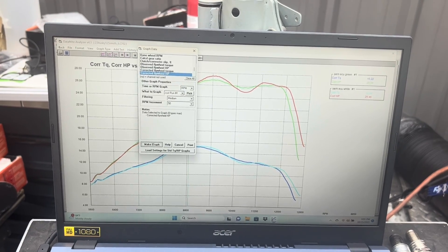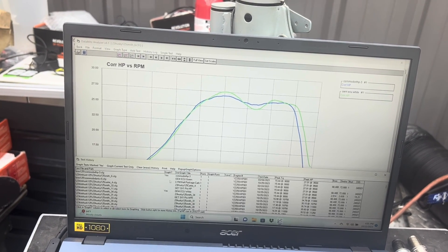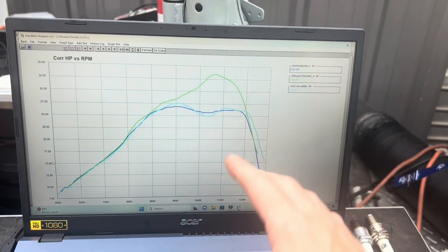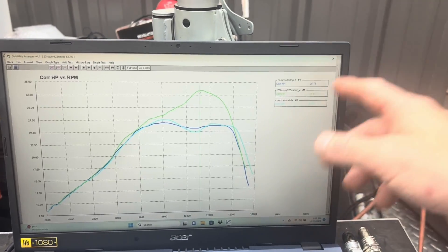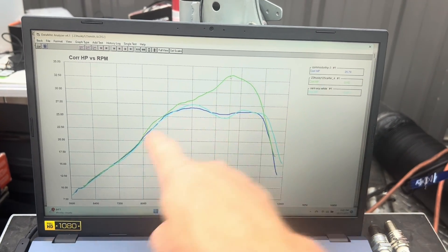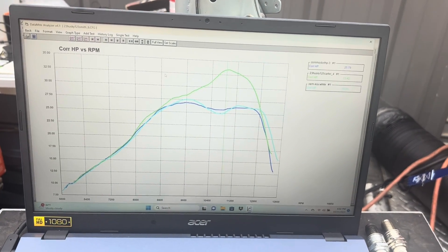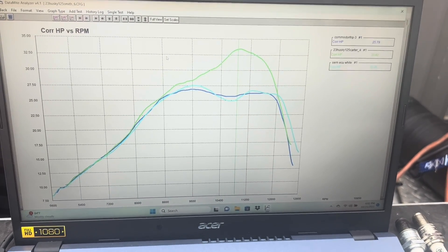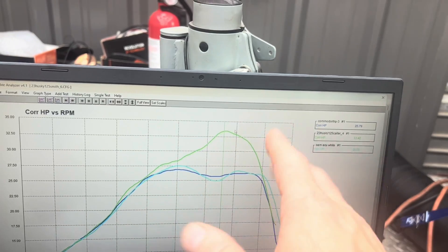Let's add the torque in here. It's just shy of 15 foot-pounds right here, and that's about what these bikes make at peak torque. So when you ride it, it doesn't feel horrible because down here it pulls about right — it just never really makes horsepower and then it revs okay. You ride it and you just go, 'well, it's not good,' and then you chalk that up to being this new bike. It doesn't run good though. Let's show you what a correct-running stock bike looks like — this is the best-running one of these I've dynoed yet, so it is the absolute pinnacle of what you might purchase if you get a fuel-injected TBI bike. Some run good, some run bad — the vast majority that come to the shop run more like this bike.